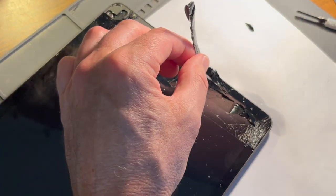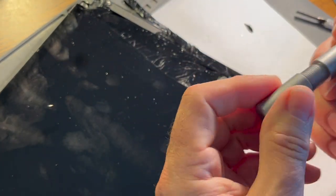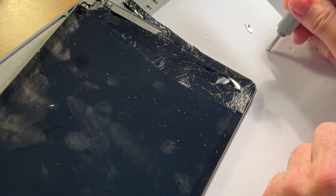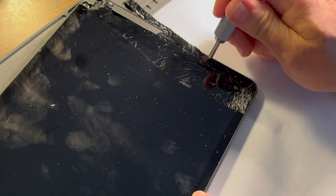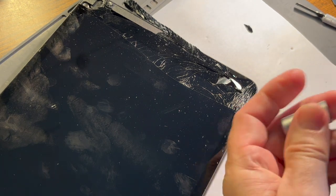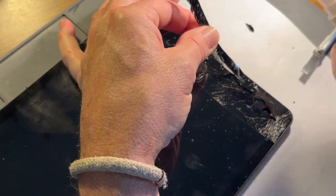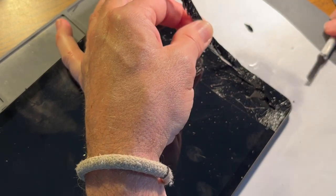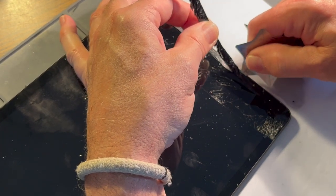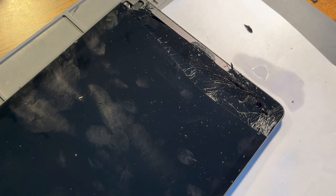There's also a tool which is actually designed to fracture the glass — it's adjustable tension, spring loaded. You push it down and it makes smaller fragments. You can get these online. Sometimes that does come in handy; a lot of times I don't need to use it. I'm going to add a little more alcohol here and try to get all this up in one piece if I can — kind of pulling and cutting with the pry tool. It ripped, but not a bad little strip.